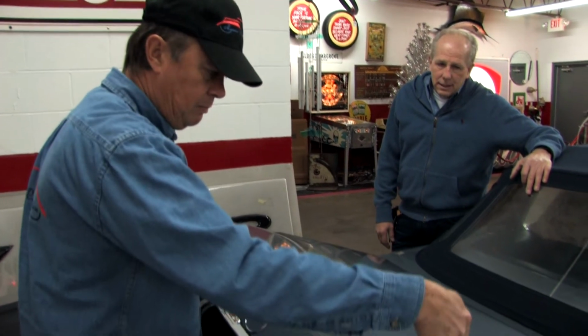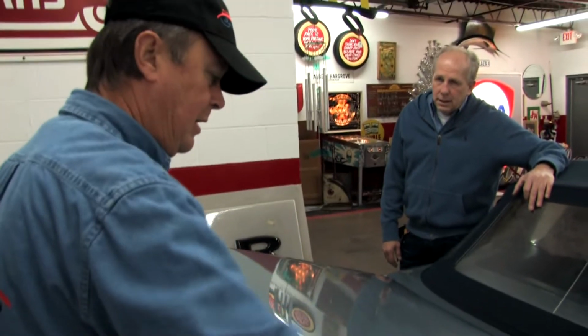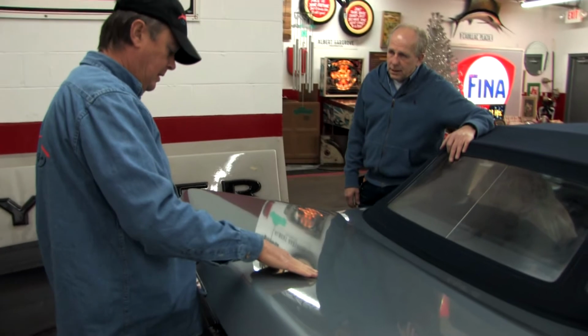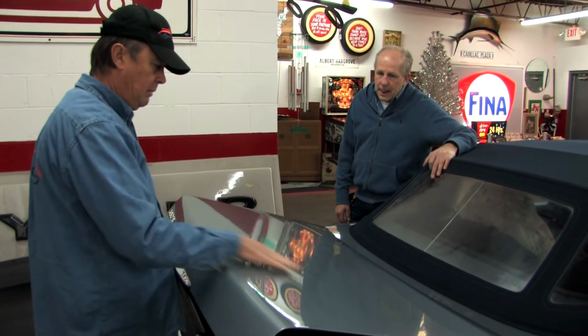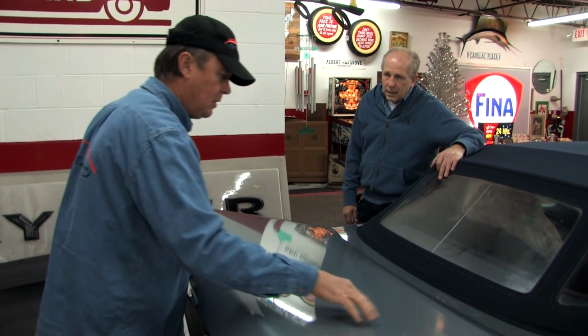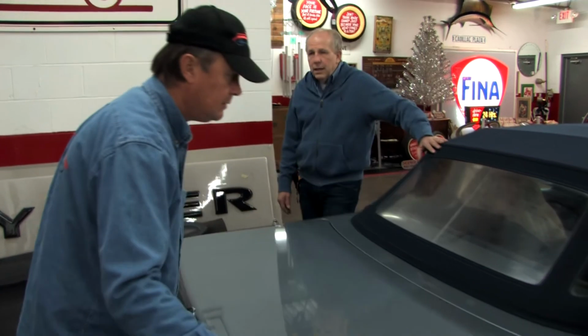I can see a straight line going down here where they had masking paper covering this up, and they tried to dust the color up here. This was probably the edge of the color then. And then they used that melting agent, and that actually cracked this other lacquer. Some of this was just your factory paint.